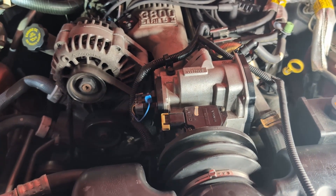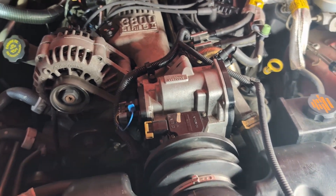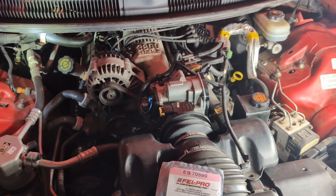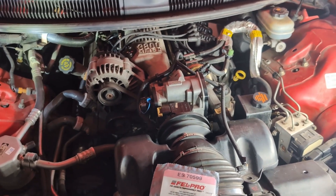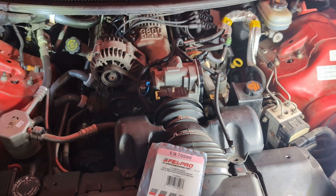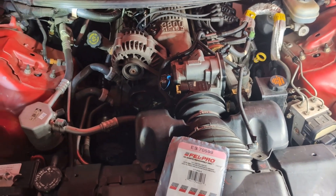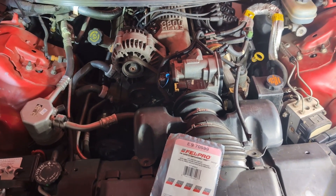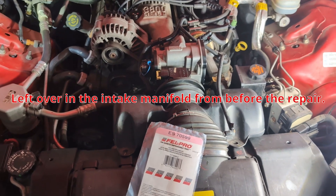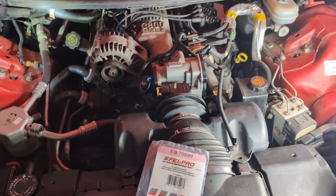When you test it, I would say don't just fire the car right up. Turn the key to the on position and see what the fuel pump does with no spark — see if it sprays any fuel out. You'll notice it; you'll see it or smell it. Bring a flashlight and look around. Keep your fire extinguisher nearby just in case, but I had zero problems and I don't think you will either. After you're pretty sure there are no fuel leaks, hop in, start it up, then come back around and look again.